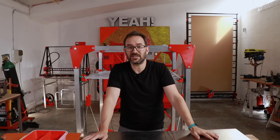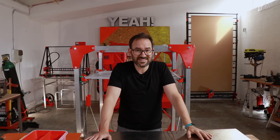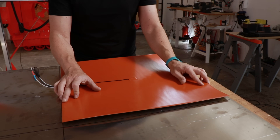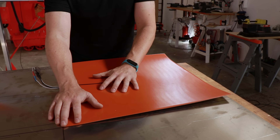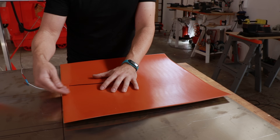Now that the ground terminal is installed, it's time to stick the pads on the plate. And there is only one chance, because once those things are stuck, there is no way to take them out. I have to be sure of two things: the first is that it is aligned, and the other is to remember to put the thermal fuse under the pad, somewhere around here.